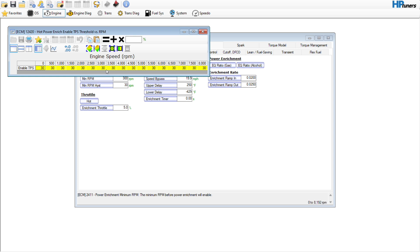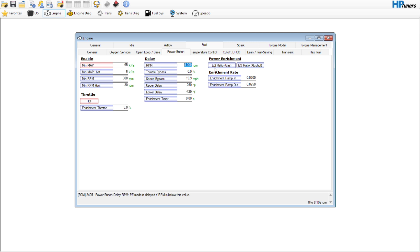It's a car, not a truck or SUV, so it is going to have much lower values for the trigger. These look pretty good already, but if we wanted to, we could say 5,000 RPM and above takes 10% throttle, and from 2,000 to 5,000 we do something like that — that would probably be okay. The delay — let's set that to about 800. The ramp in you can do 1.0 or even like 1.3.